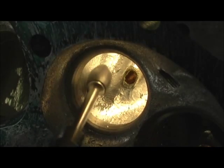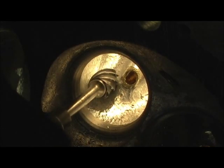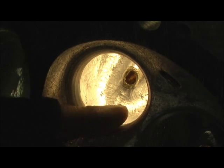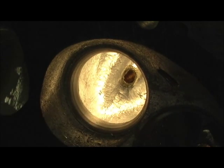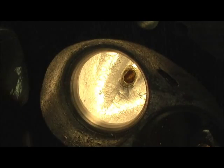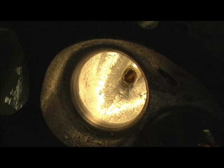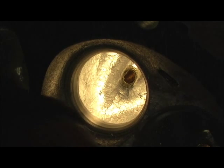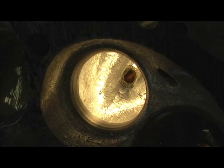Alright, now that rolls in pretty good right there. It's that little bit of time and finesse with the different blenders to roll it in to form a more aerodynamic shape. A radius in your blend really picks the airflow numbers up without having to remove a lot of material across the cross-sectional areas.